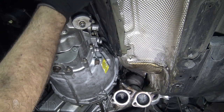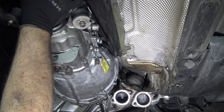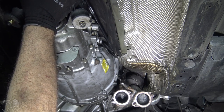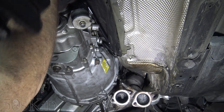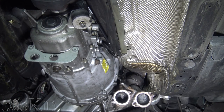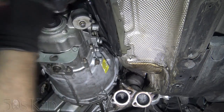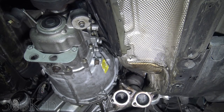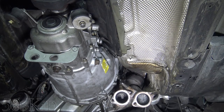That's the one that's usually the most difficult, but it's easy as long as you remove your engine mounts. That is the key to making this whole job easy. And that is all the bolts for the transmission.